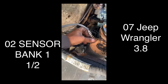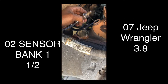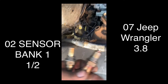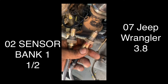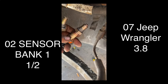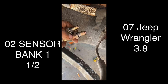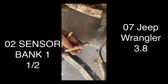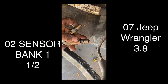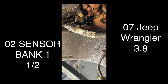Don't make this mistake I'm gonna show you. The upstream - here's how it looks. When you get sensors you're gonna get one upstream and one downstream, so here's the difference right here. If you get all four, don't be mixing them. If you order online be careful because I've seen them sending four of the same kind, and then you're gonna have problems. Buy the original parts. The fat one is downstream and the skinny one is upstream.